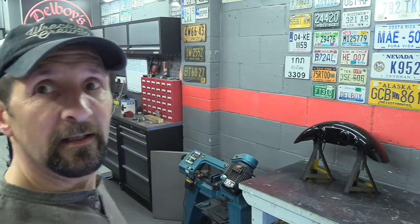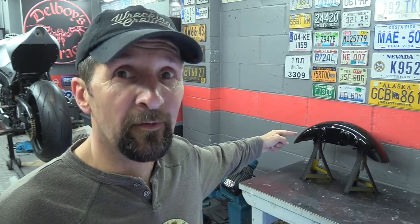Right, really, really super chuffed with that. I'm going to leave the garage in the mess it's in. If you've ever done this kind of thing, you know that this is one of those times: don't clear up. Leave the dust exactly where it is, because if you start moving that dust around in order to clear it up, even if you use a vac, the vac itself emits wind. It blows as the vacuum motor turns to suck up the material, then that's blowing air around inside the garage and everything is going to stick to that like flypaper. So while that is absolutely soaking wet gloss at the moment, I'm just going to leave it there, quit while I'm ahead, very, very much ahead.